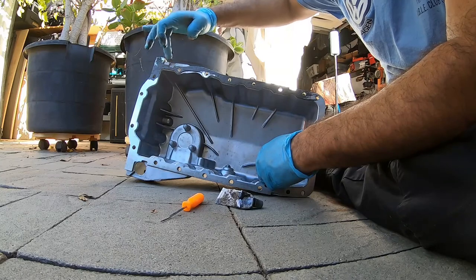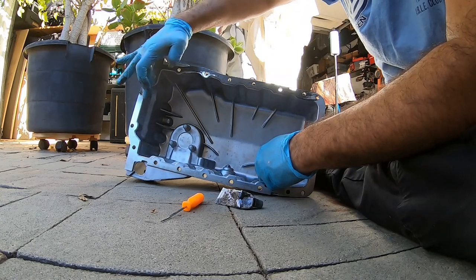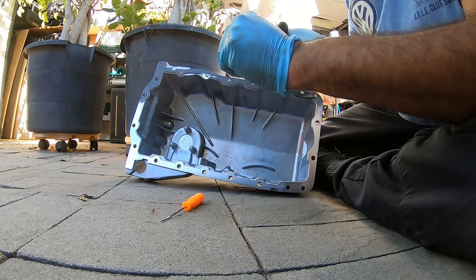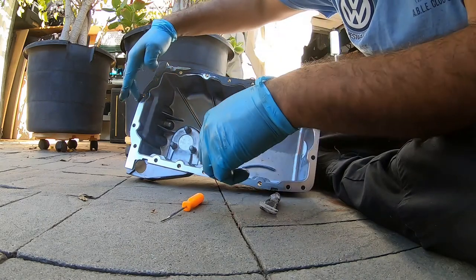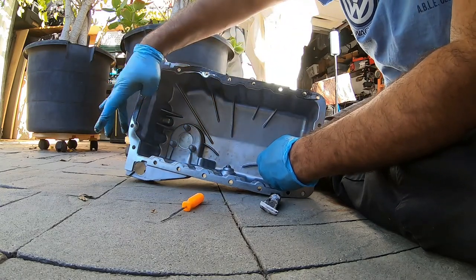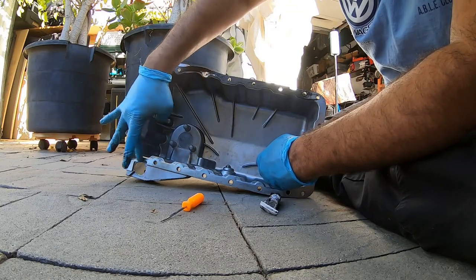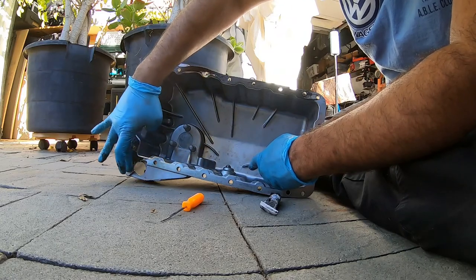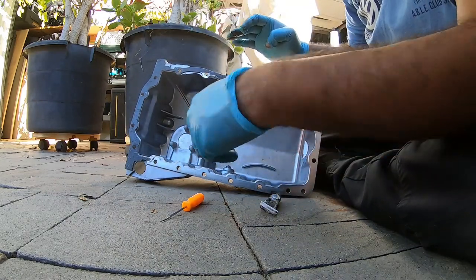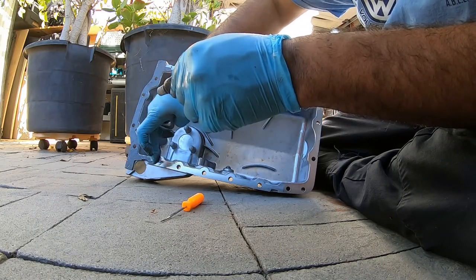So we're going here. Again, we're working our way down. Now, you don't have to work fast. The RTV will cure, all right? Which is okay. You want it to cure and you want it to get tacky. The longer you let it sit out, the better. Now, don't let it sit out too long because then it won't stick. Again, you're making it sticky. You don't want it to be slippery like it is right now when it's fresh. We want it to have kind of a sticky surface to it.